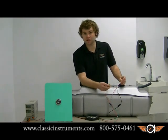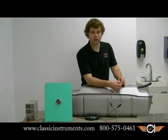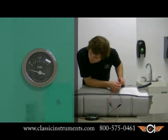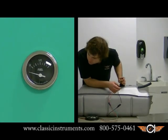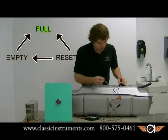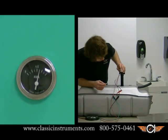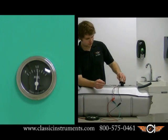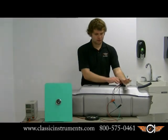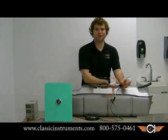With the fuel sender reinstalled into the tank and the tank filled up to full, we're going to again touch the calibration wire to 12 volts for 10 seconds. Now after 10 seconds, remove your wire and it should go back up to full. Verify that your fuel gauge is working by picking out the sender, dropping it back in, and making sure that it's sweeping. If it does, that means calibration is complete. Reconnect the white wire to ground, and we're complete.